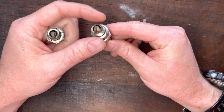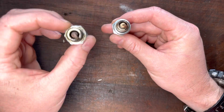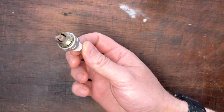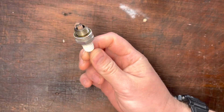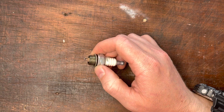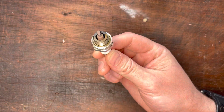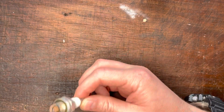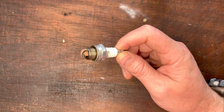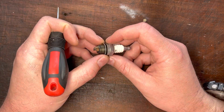The first thing I want to say, and a myth I want to debunk, is when someone runs an engine, pulls their plug off, looks at it and says, 'Yep, that's running rich, that's running lean.' You can't do that. A plug cannot be read just by looking at it after it's already been run in the engine, because it's going to have been run at different rev ranges. You can have a rich low speed screw idle and a lean high speed screw. You could be looking at it and it looks chocolatey brown, but that's because you spent more time idling than at full throttle. So I'd suggest forgetting about that — don't even waste your time. If someone says that to you, you can safely ignore it, because it's not true.